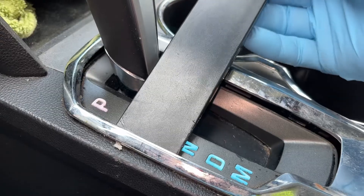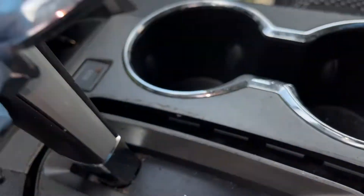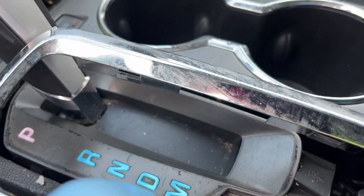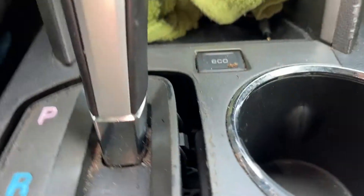On the driver's side, you're going to come in at an angle this way — push in and up, in and up. The reason being is because there are tabs. See those tabs? They sit right here and here, so you have to push the chrome piece in at the bottom, away and up. If not, you'll break the tabs.